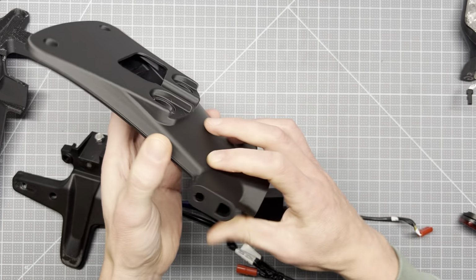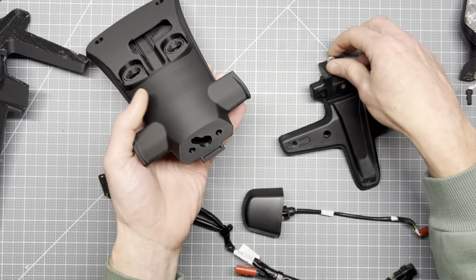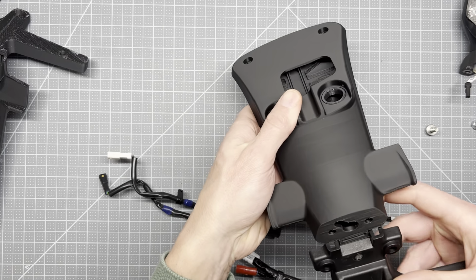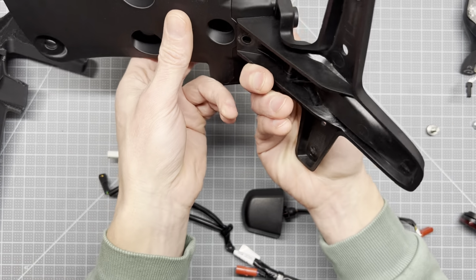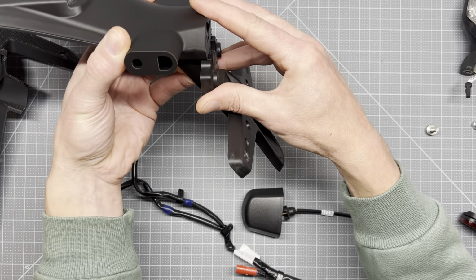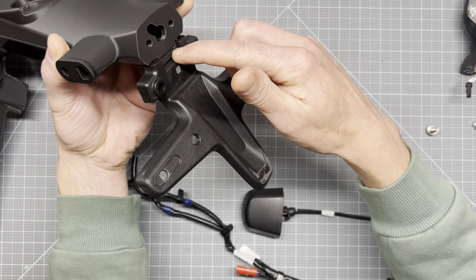So, go ahead and do our assembly. The new thing on this one that I've added, we'll see later when I bring everything together. Get this off real quick. When we get everything together here, notice I have this little slot here, and that is a drain hole just in case. It's going to be sitting on top of the tail, under the tail, right? So if any moisture or water somehow gets in there, it's all going to come downhill and exit out of this slot.